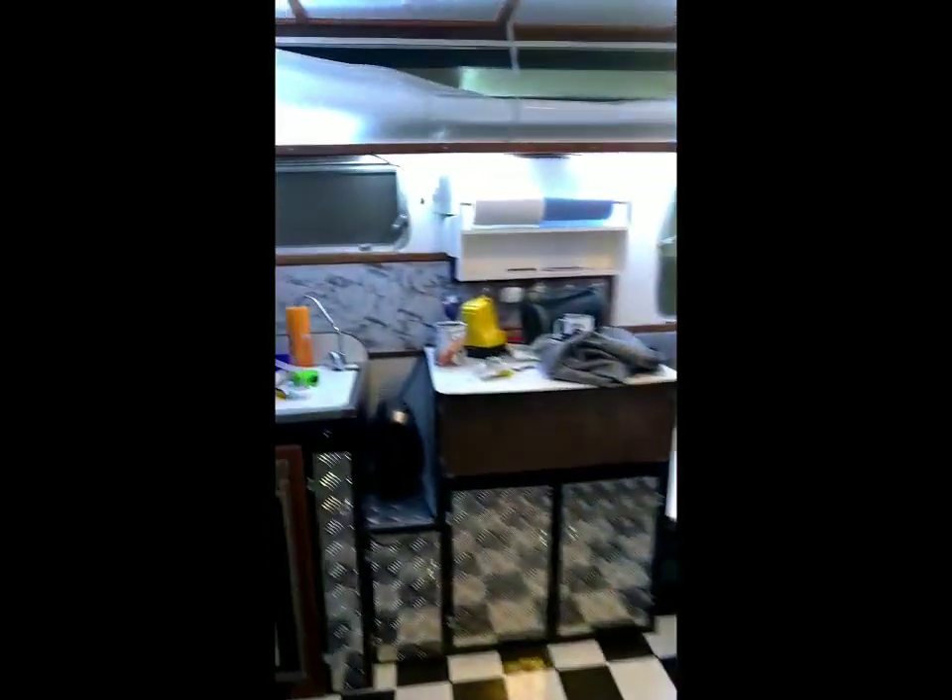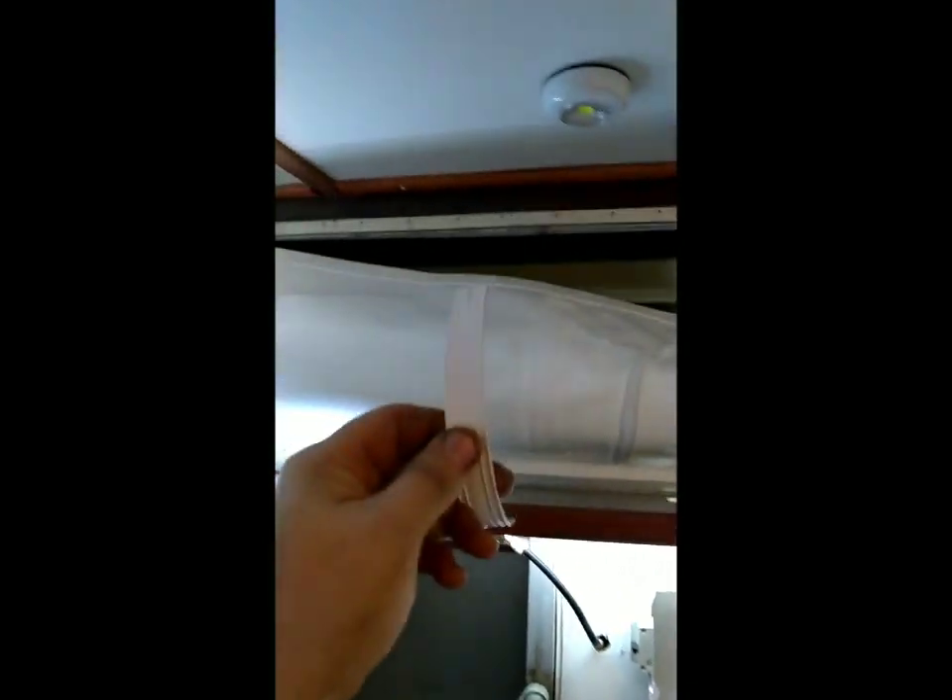After a long, extensive time — about an hour or so — a little banging and straightening up, we've got it all in. It's all in here. Hardest parts are these corners. That's all in — it's looking a lot better. Now I'm going to do inside of here. The ribs. There's four ribs on the sides, two on the ends. Make sure that when you install them, you go bend in — that way when the top comes down, the canvas actually bends inwards. They actually go in this way.